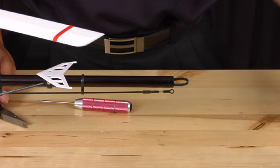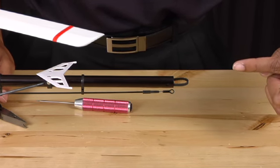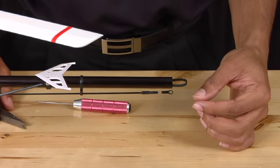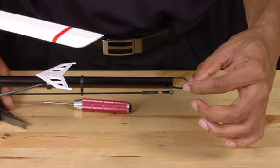The way you do this is by looking down the tail of the helicopter, and you'll be able to see whether or not the belt is straight with the pulley. Once you've confirmed that the belt is straight, simply rotate it 90 degrees in a clockwise direction.